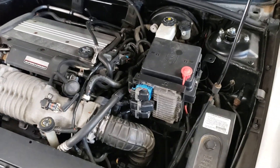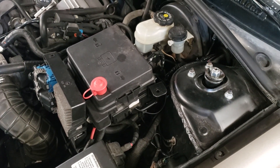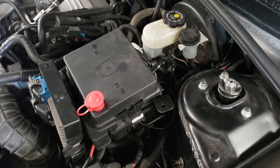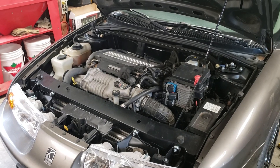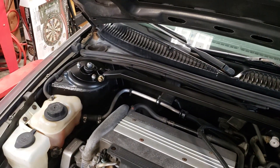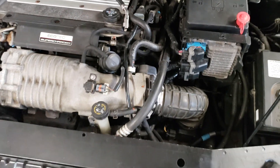Another small update — I finished cleaning up the wiring under the hood. It's all tucked away. I redid one connector, soldered it a bit shorter, cut a few wires shorter, resoldered, and tucked everything underneath the fuse box. It looks a lot cleaner. Now I'm going to install the front strut brace. Got the strut brace in — that was pretty easy. Looks pretty good; probably doesn't do a whole lot but I think it looks cool. I also have this AC hose that's been hanging out, so I need to figure out what size fittings I need and get those ordered.